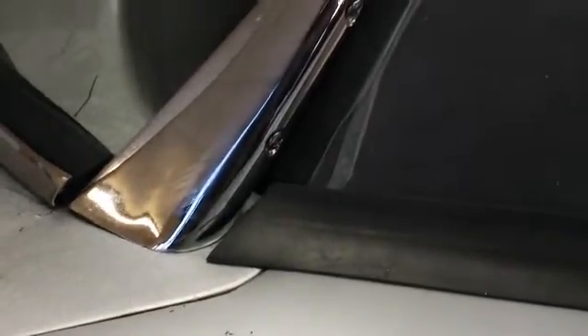First of all, let's go back to the famous windshield connection. Right here we have the same problem that we have on the original side curtains — it's open, there's no way it can be sealed permanently, it's too flexible. As you go up the windshield, you'll notice there is a gap between the rubber and the windshield. That's not a problem because it is behind the windshield and it does prevent the flow of air and water from getting between the two. Unfortunately, we have our penetration point up here at the top — unavoidable, you will get a leak there.